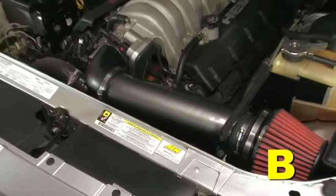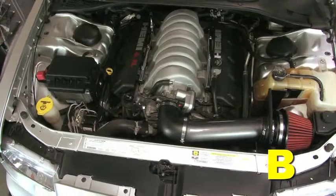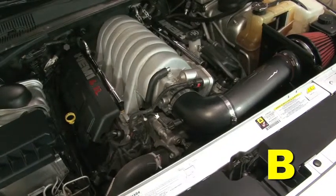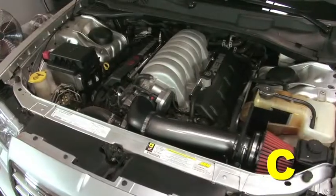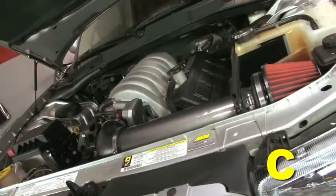Check for proper hood clearance. Readjust pipes if necessary and retighten them. Inspect the engine bay for any loose tools and check that all fasteners that were moved or removed are properly tightened. Reconnect the negative battery terminal and start the engine. Let the vehicle idle for 3 minutes. Perform a final inspection before driving the vehicle.